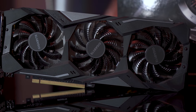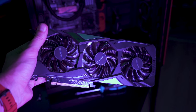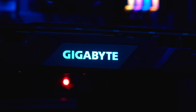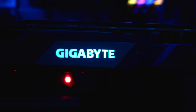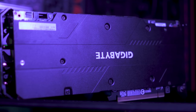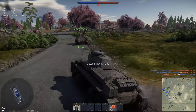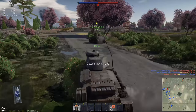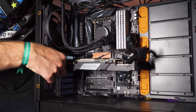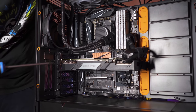I've chosen the Gigabyte RTX 2060 Gaming OC Pro 6GB card. This card features a factory overclock with a GPU boost of up to 1830MHz, compared to the reference 1680MHz. It also comes with Gigabyte's WindForce cooling system, RGB lighting, and a full cover backplate. Gigabyte is using a custom PCB with a 6+2 power phase design, compared to the 4+2 reference. The factory overclock gives you a few more frames in games and better performance for heavy effects in your videos. The Gigabyte logo also has RGB backlight controllable via the motherboard software.